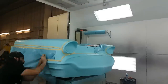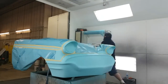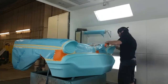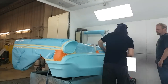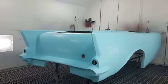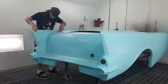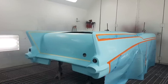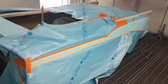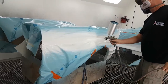One of the things I like to do is put the paper onto the car and lay the tape on there, then move the paper where I need it. Sometimes it's easier to use a long flat surface to lay that tape on the edge of the paper rather than trying to put it exactly where you want it. Fill any remaining areas with double-wide tape. Now onto the rear — we're just gonna do this in photos. It really is just repeat what we did on the grille: measure, pinstripe tape, masking tape, mask with paper. Then we get Mark to start laying down some paint.